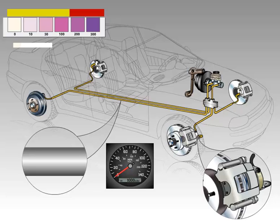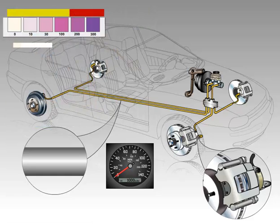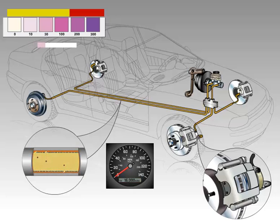Brake fluid is hygroscopic, meaning it can absorb moisture. Over an extended time period, water can enter the brake system and aid in the corrosion process. To prevent corrosion of metals inside a brake system, the brake fluid contains corrosion inhibitors that coat the inside of the brake line. As moisture is absorbed into the fluid, the corrosion inhibitors become depleted.